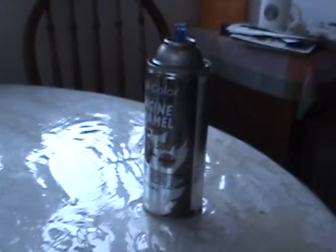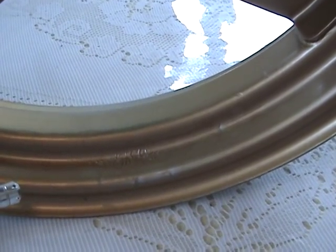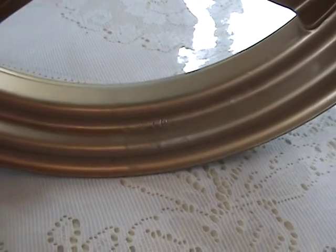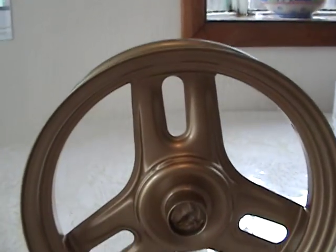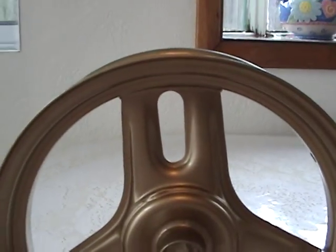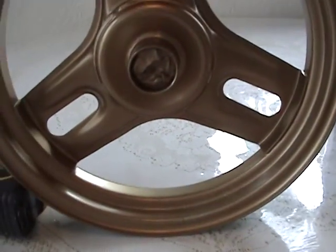So I'm going to give it a couple more coats outside, and if I have more problems with this, it will have to be sanded out again, but I'm going to paint the rest of the rim, and then I'll just keep painting it until the rim looks good enough for me. Then I will put the clear on, sand the clear down a little bit and polish it out. But I need to get the base coat on there perfectly, on the inside of the rim,